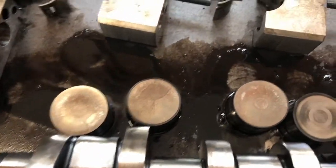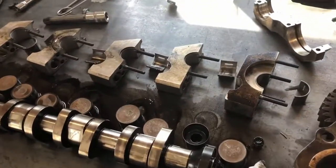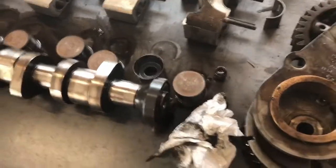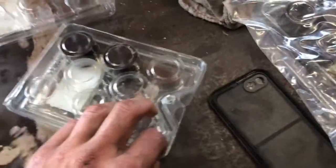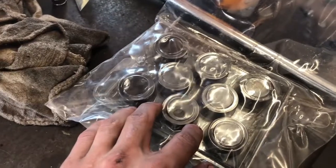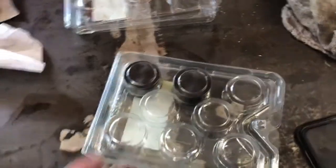And then as far as your lifters and your bearings, they actually use the same style as the BEW or BRM. So the only issue is over here I've got packs of INA lifters. So 2 full packs. A pack would do a 4-cylinder fine. So I've got a full pack, and then it would be a half pack that you need.